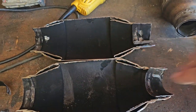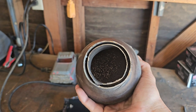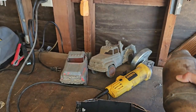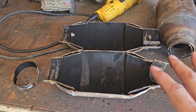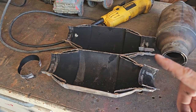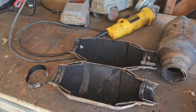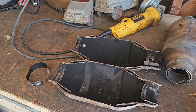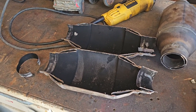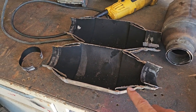This one is obviously no good — basically it was a muffler at this point. This one is still good because you can see the mesh is still in place on both ends, and this is actually what's doing the work of the catalytic converter to burn off the exhaust emissions. The reason why this catalytic converter doesn't have that second interior wall with the insulation is because this car is from 2006. The law went into effect in 2009 that changed it so that catalytic converters in California had to be California compliant. This one predates that — that's why you're not seeing the interior insulation between the primary and secondary piping.